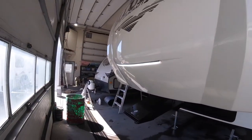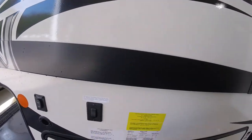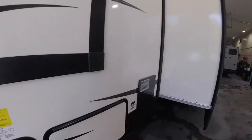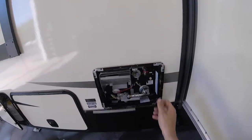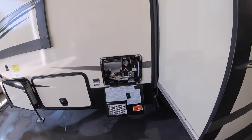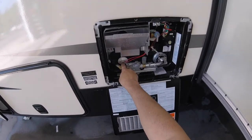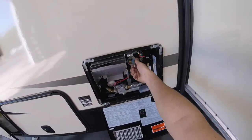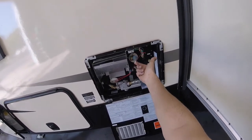There's a button here for some lighting on the front of the trailer. You have your hot water tank right here — this does operate on electric and gas; the switches are inside. You have your drain plug here to drain the system. Make sure to release the pressure using the pressure release valve, or by opening one of the taps inside, before removing it.